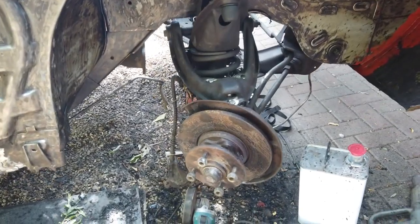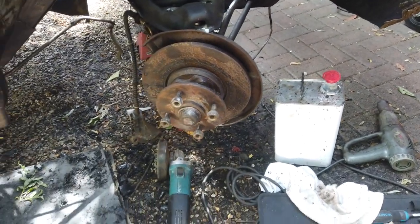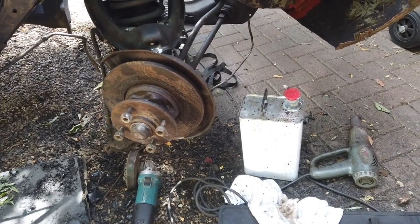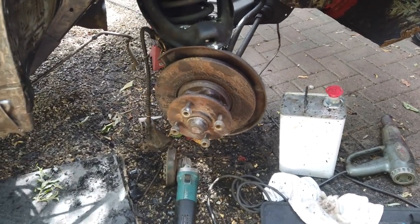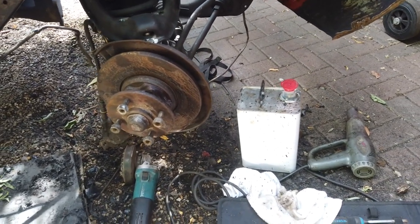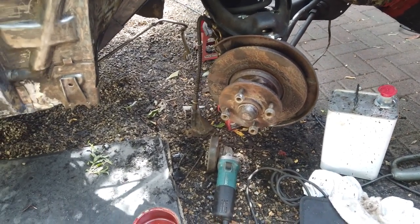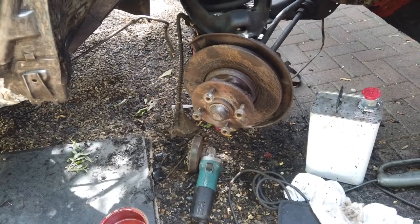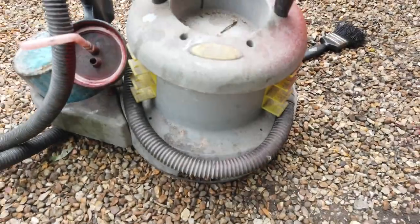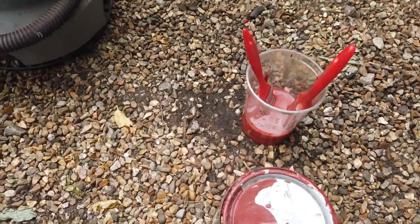With the welding finished I'm just getting all the underseal off here to see if there's any rot underneath the wings. But it's pretty clean - there's nothing to weld under here. A little bit of rust treatment needed, that's about it. We're going to cover this with a Raptor colour-matched, or some Gravitex - I'll see what I've got in stores.